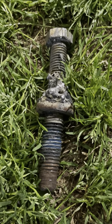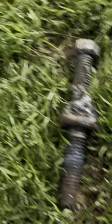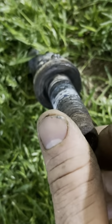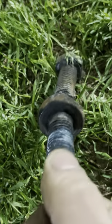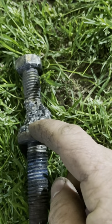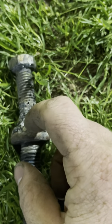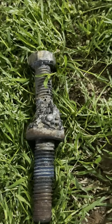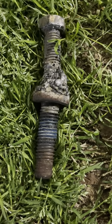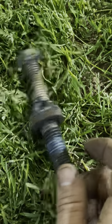Most of these vehicles have a plastic fuel tank, so again, not a safety video — not something you should try at home. When you're removing this receiver hitch, you might notice something kind of strange about this bolt. That bolt has absolutely no facets. It is a perfectly round-headed bolt and does not appear that it's intended to ever be removed. It looks like these things originally had a small stud coming out of the top, and then probably had a faceted head attached to that stud. When they impacted this thing up into the vehicle, that would snap off that stud and knock the head off.